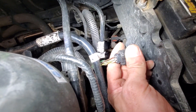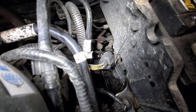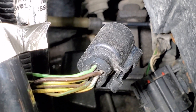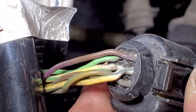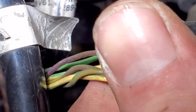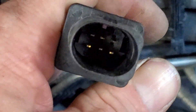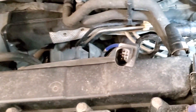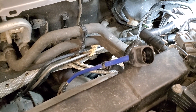Right there in the middle, that's the white and blue. And on the other side there's the white and green. So we've got the two middle terminals that operate the heater. Just looking in the connector, everything looks good there. Also looking in the connector on the sensor side — don't see any moisture or anything like that. So we'll go ahead and take a resistance measurement of the heater there and see if it's just burnt out. I'm sure it's probably just that simple.